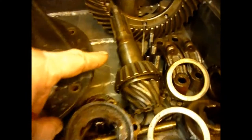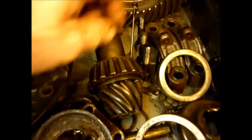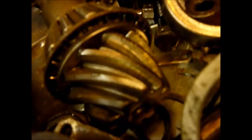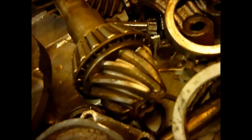We're going to use the carrier bolts — I'm going to get those aqua-blasted. These have got little holes in and these will be rewired. The crown wheel and pinion has completely had it. The pinion here has got very heavily marked, nasty marks on it. It's really not very nice at all. The crown wheel equally, although you can't properly see it here, has got very heavy pitting and chipping.